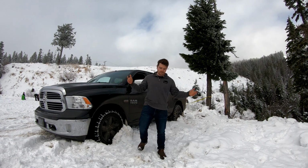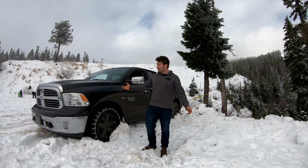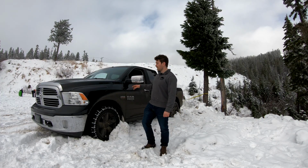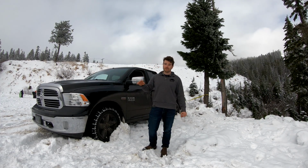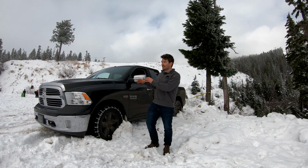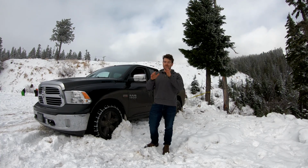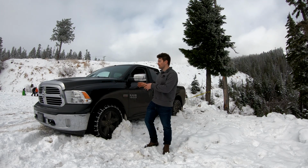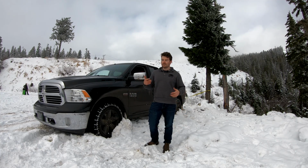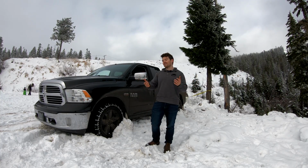So, like I mentioned in my last video, if you are going to be going off-roading seriously with your Dodge Ram 1500, really make sure you know what transfer case you have, because there are limitations to the BW4444. And this is not the only situation where the clutches disengage. If you watch the last video I made, there are a couple more situations, but this is the one I thought was the most interesting, because when you're off-roading, you're going to be turning your wheels a lot, most likely, and you want to have power to your front drive shaft all the time if you're off-road, or 4x4ing.